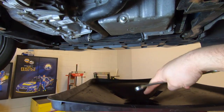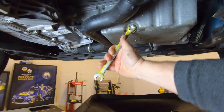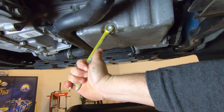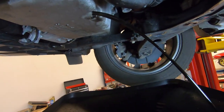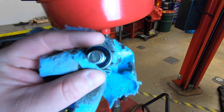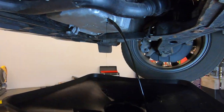we're going to make sure we have a suitable oil drain pan. We're going to go ahead and remove the drain plug bolt, which is a 15 millimeter. After we remove the drain bolt, we're going to go ahead and inspect to make sure the gasket is still there and it's in good shape. We'll clean it off, put it to the side, and wait for the oil to finish draining out.